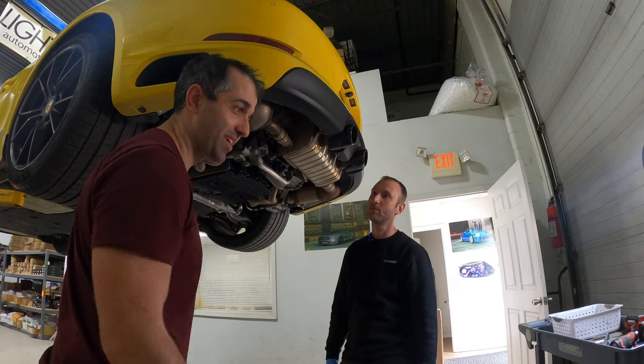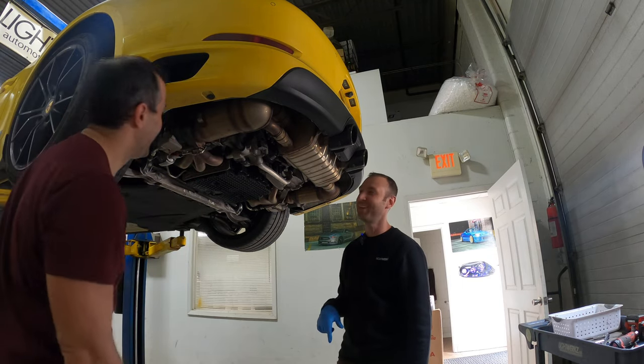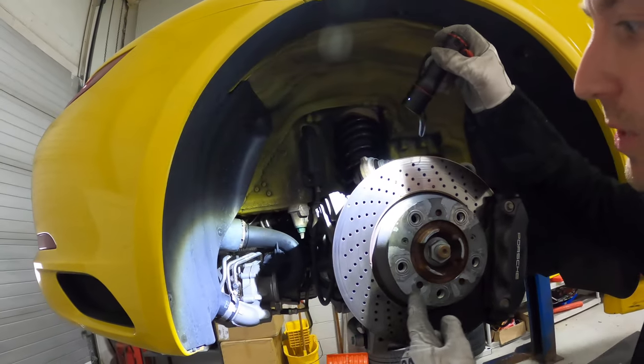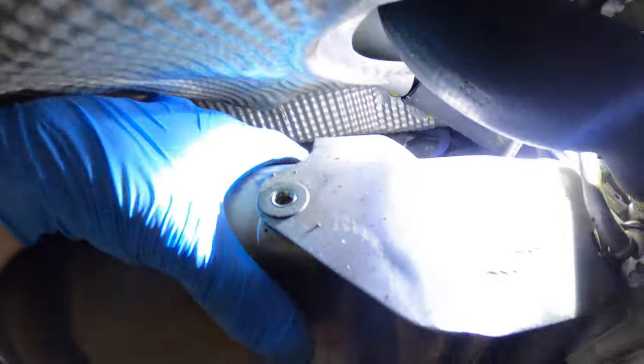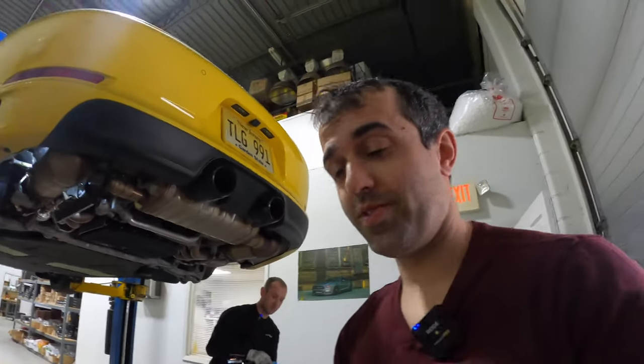I made a mistake and said this was going to be easy — that's mistake number one. It's going to be a hard job. You might want to remove the rear passenger side wheel to get access to the heat shield screw. There's one on top of the cat, one here, one here, and then one all the way in the back. He said three hours for this job — let's see.